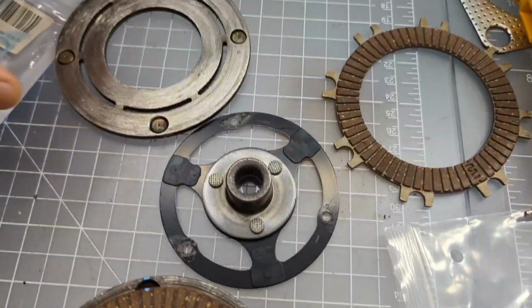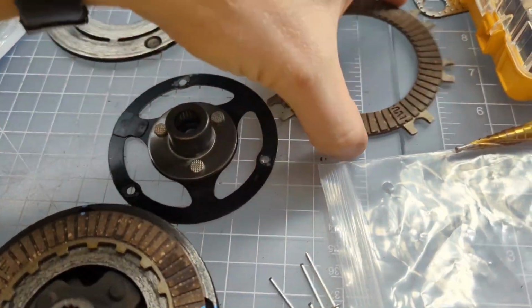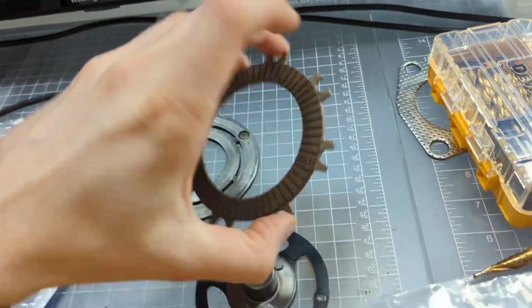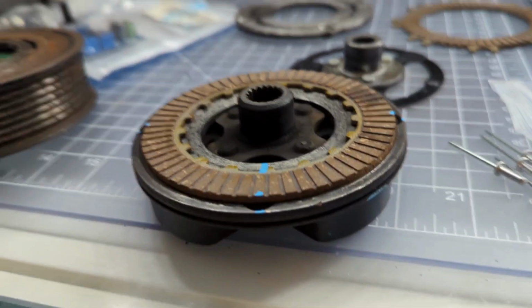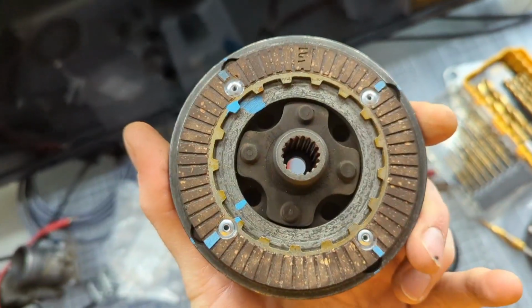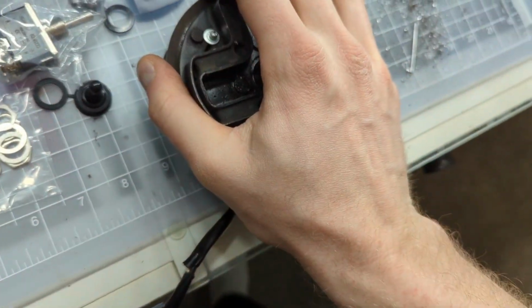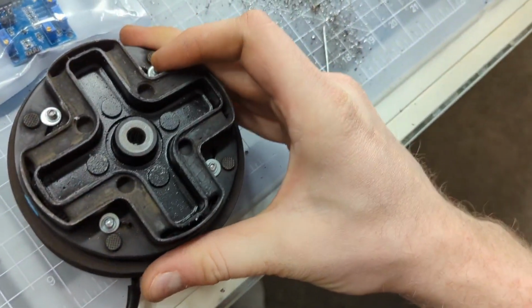So as a next approach for reducing clutch slip, I've got the small motorcycle clutches, and I'm going to take one of them and rivet onto the original SC14 pulley. The clutch is now secure to the pulley. Curious. So it's like it doesn't want to be perfectly centered.